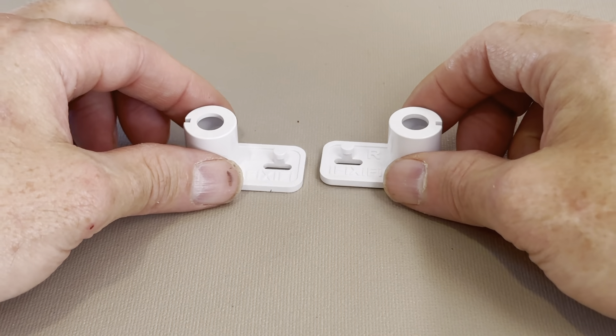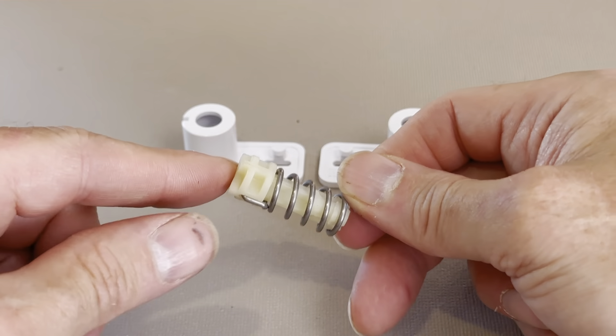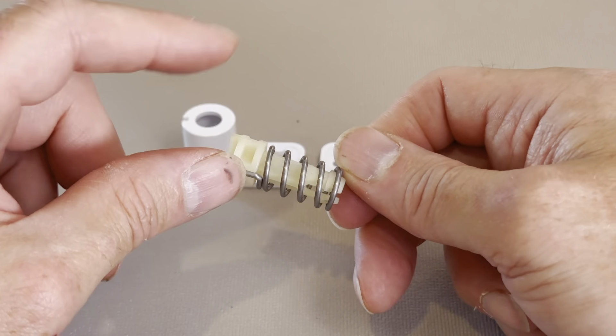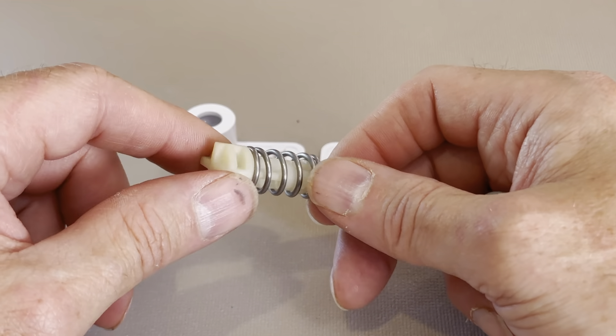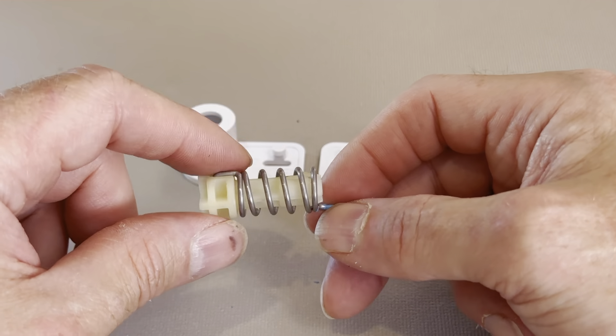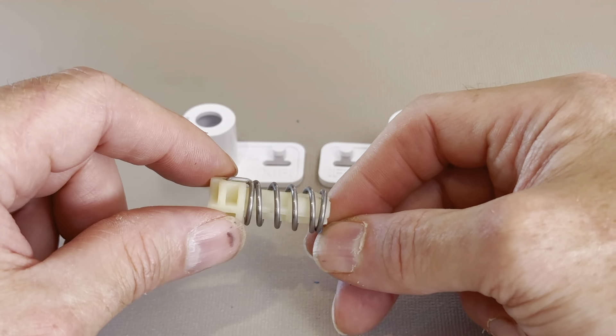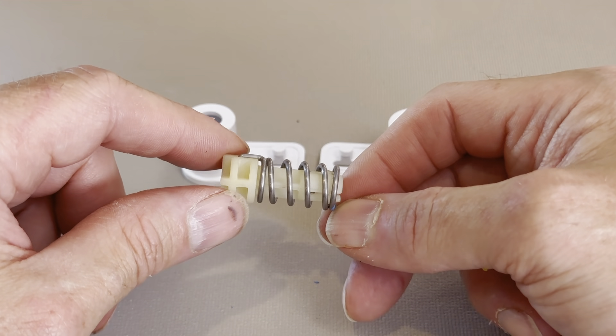So that's the spring housings. Now another way that your freezer door can wear out or break is if you have a problem with the bolt or the spring. These definitely do get old and wear out with age. I've seen the springs rust — I think those are knockoff springs. I've also seen them break, and the bolt can shear off or break if it's overstressed or overloaded.